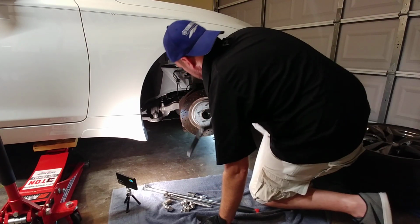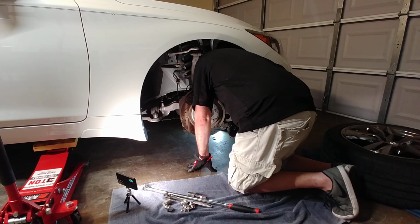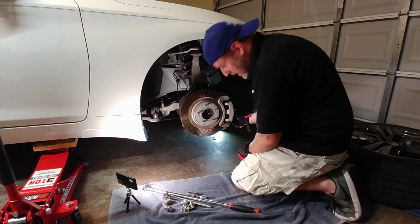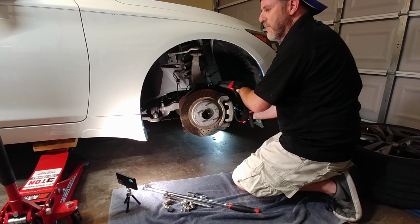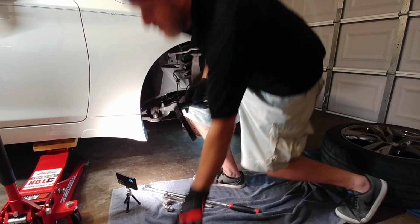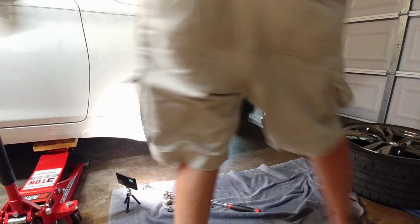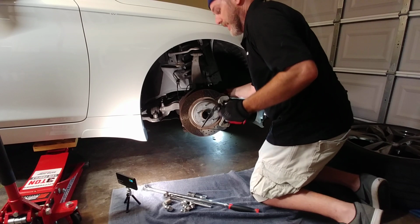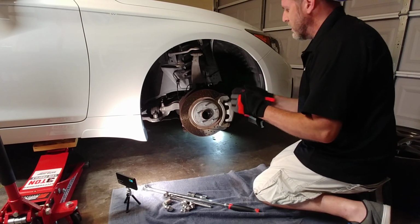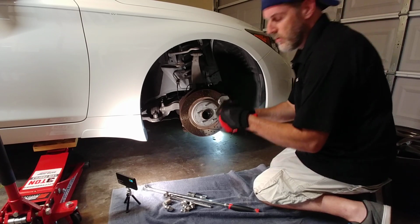Okay, I'm going to go ahead and inspect and take a look at the insides of these. I torqued everything on. The bolts, I got to remember I'd written them down. I think these were 25 pounds. There's not a lot of torque, even though I think those are 17s in the rear. Actually, let me see. The two big main bolts, and this may be different for 2019. Hang tight. Okay, I got a 20. I just can't remember. This video is going to be long, and I apologize. Okay, so I was correct. The smaller ones may be 17s, but the two big ones that really structurally seal the suspension are a 22. So a 22 millimeter socket.